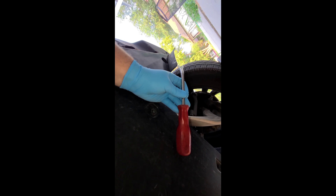I got that off — I just spun that carpet piece away. Right there's your oil filter, right there's your drain plug, and it is a 15 mil. I'm going to go ahead and drain this oil and loosen that filter.